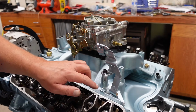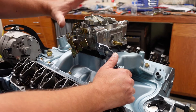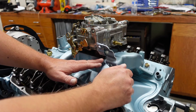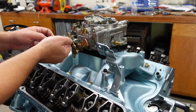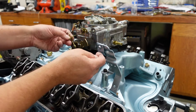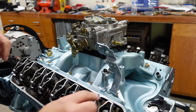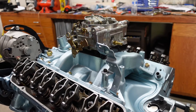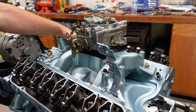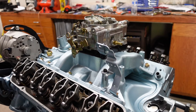I've been playing around with my original carburetor bracket, and now that this thing is an inch higher on a different manifold, it lines up pretty much perfect with this post here. I'll get the proper end for my cable, so I should be all set. I'll touch up the paint on this a little bit. I'm going to go pick up some new hose for the PCV and for the brake booster — since I'm doing a complete rebuild, might as well have new hoses.